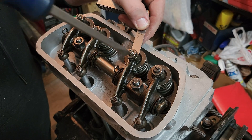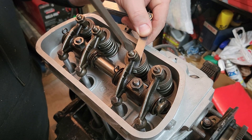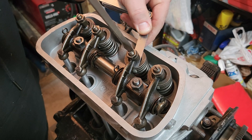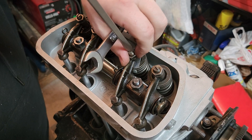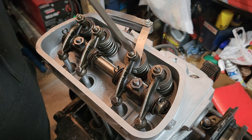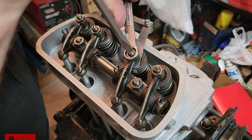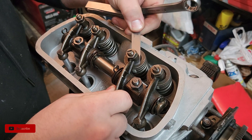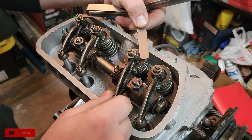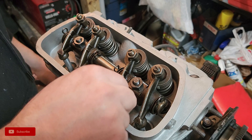You can see that one is way out of whack. The way that I do my valve adjustment — see, it's kind of nice, nicely trapped. It's in there good, it's not going anywhere, and it won't fall out either. We'll check it again real quick. Yeah, see that nice drag I've got going on there with that six thou. Very good.